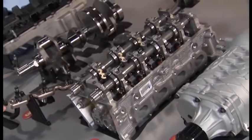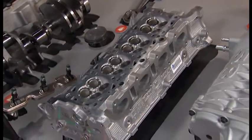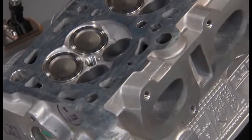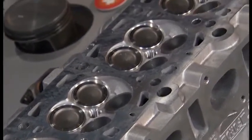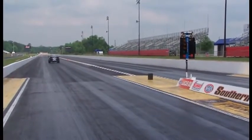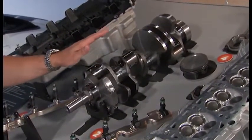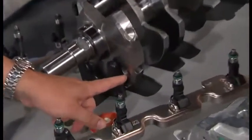The rest of the changes that we made on the head assembly are related to making the head and the engine durable — making it live under the extreme operating temperatures and pressures that we see with this engine. Now we've turned the head assembly over so you can see the business side of things. Here you can see the upgraded exhaust valves — they have a stellite hard face on the seating surface of the valves. We've also upgraded the valve seat inserts in the head itself so that they can withstand the high operating temperatures and pressures that this engine sees. In order to properly balance the added mass of the 5.8 liter pistons we had to change the balance characteristics of the crankshaft. We've added a tungsten insert here that you can see pressed in.